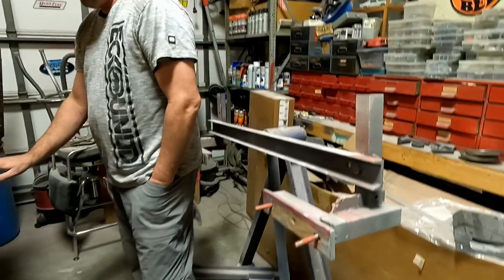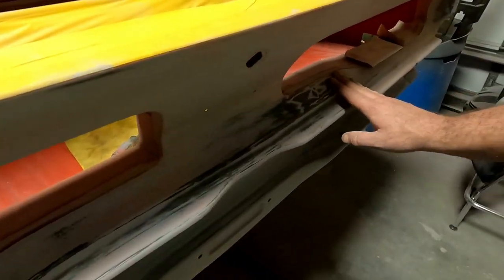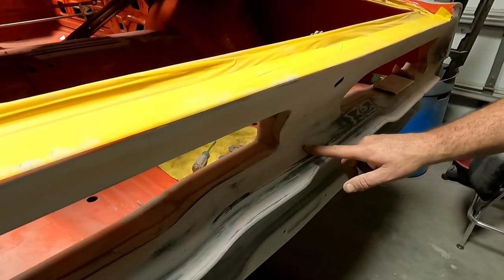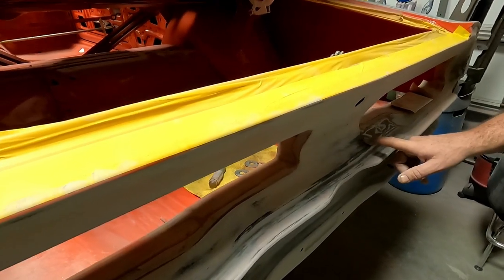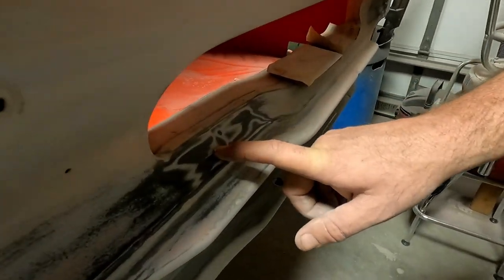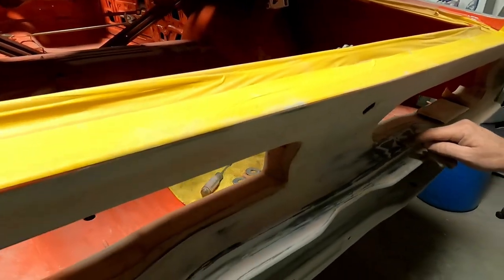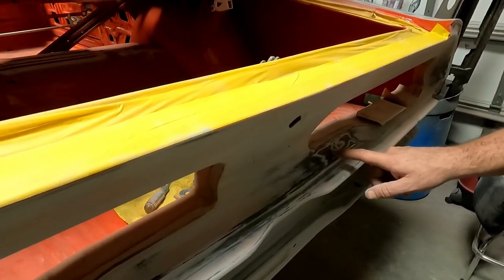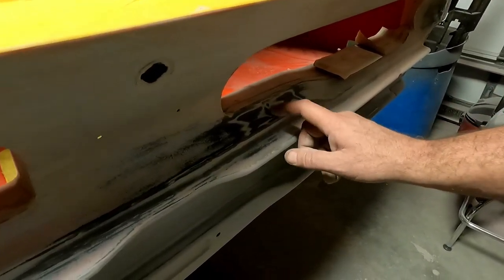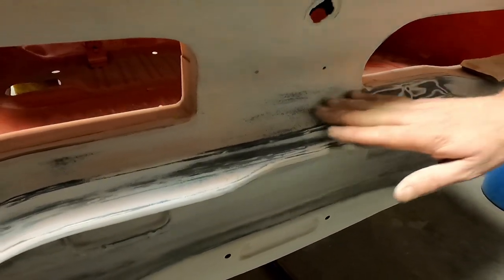You can look at this. And then roll the... there was a dent here. Oh, there was? Yeah, there was a dent. But all my layers of primer, you can see there's a little hint of red overspray, but gray, black, then gray, then black, then gray. No, this is top. So I had to go through 4 layers, and this builds back up. This is the top layer of gray, or top layer of black, and barely any gray. There was red in the center of that, but it allowed me to sand everything down to where that's beautiful.